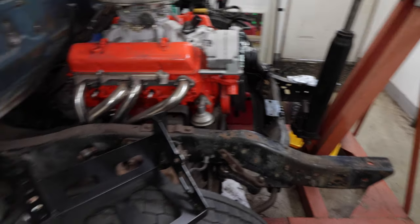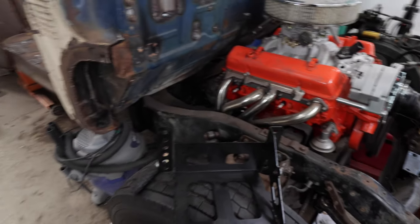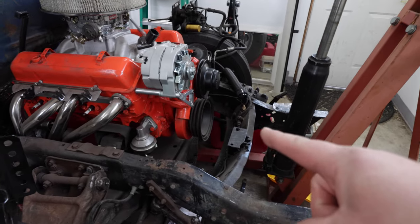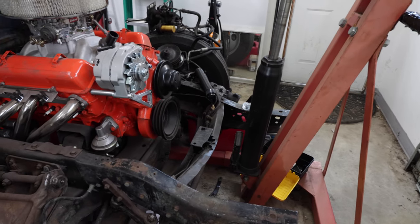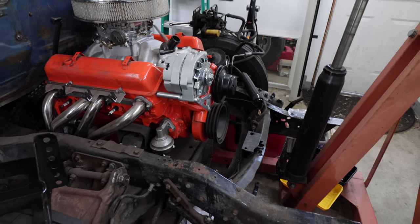You can see some of the work I've done here. This is obviously an '82 Chevy GMC one-ton frame, and I've spliced and custom-made all of these cab mounts to be able to fit it, welded those in there, and then welded in a plate there. That's what mounts the front section — the whole front fenders, front core support, aluminum radiator, and things like that.